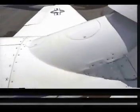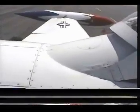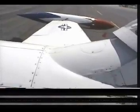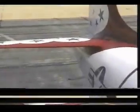Looking over the airplane — 90-gallon fuselage tank here. This is the access panel for your float valves. This is a closed filler tank, but it accesses the main fuel tank for float valves and the fuel being pumped in from the wing leading edge and tip tanks. Behind the plenum chamber — the whole plenum chamber comes off for breakdown inspection, checking the engine and oil. This is called your saber drain — it's your vent to the main fuel tank and it has to be open. The little lights in the cockpit that were added are for overfilling the fuselage tank; if there's anything venting out of there, it's going to tell the pilot. It's a nice system to have.